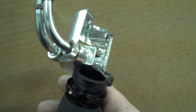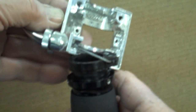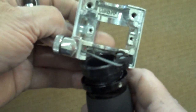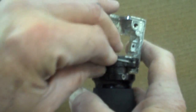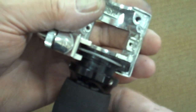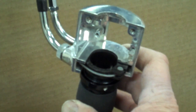If you've got enough play in your cables, go ahead and put the throttle back together. The throttle tube on the Avon grip is a little bigger diameter, so it requires a little more play in the throttle cables to go back in. Hook the throttle cables in outside the housing and then rotate the throttle to rock it in there. Don't put too much pressure on it — pull that cable over the top and it should pop right in. Make sure there's a little play and that it rotates freely and snaps back. If there's not enough play in the cables, we will proceed with the adjustments.